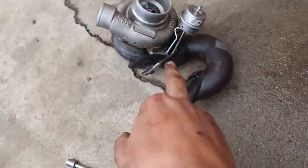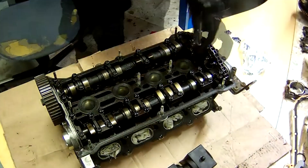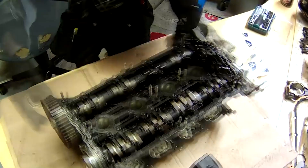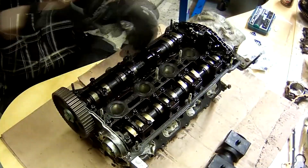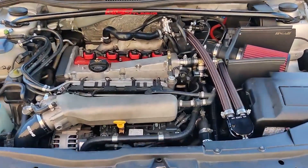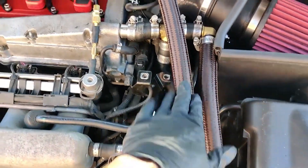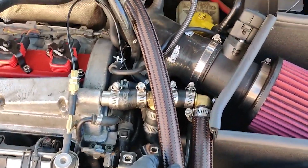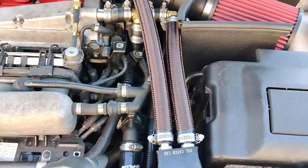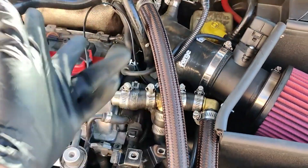For the head, upgrading the cams to a 260 or 262 cam could really help, and doing valve springs and maybe even porting and flowing the head will all be beneficial to the total build. To ensure everything stays cool, get a big oil cooler. An oil catch can is also recommended — with a catch tank you can keep oil and oil vapors away from the intake, which is important because oil entering the intake reduces octane and thereby costs you power.